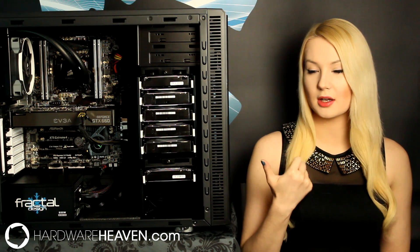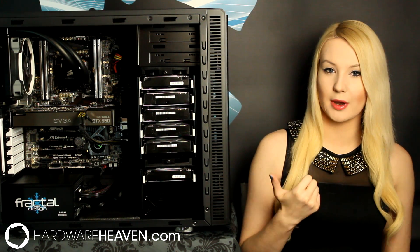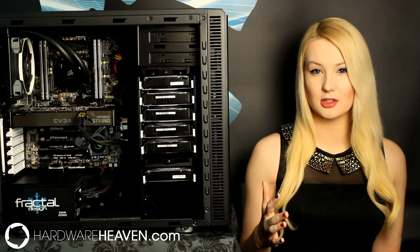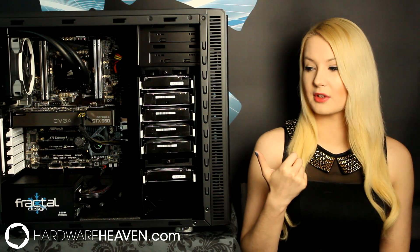For those reasons this kit is great, and Kingston also offer lower MHz kits of the HyperX 10 Year Anniversary memory. I wanted to include 16GB of G.Skill 2400MHz memory in the comparison, but this motherboard is very picky and I couldn't get it stable, so I'm very impressed the HyperX was stable at 2400MHz. This memory also has a lower XMP profile, which I like as not many kits offer that. My main criticism is the green PCB — I wish they'd gone with a black one — but once it's in the rig you can't really see it.